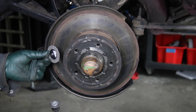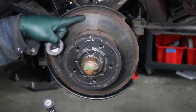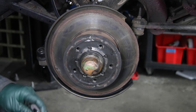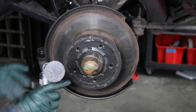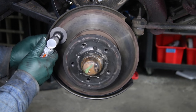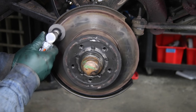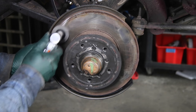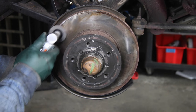There's nothing really wrong with this brake rotor in this picture, but it does have a little bit of rust along the outer edge. Watch how slick it is — the pads just twist-lock right onto that little adapter. Once tightened on, you can just keep spinning the rotor as you work the fiber pad along the outer edge to get all the rust off. Be sure to wear a dust mask and face shield when doing this.